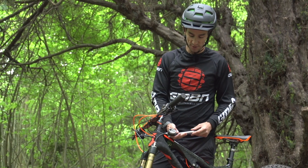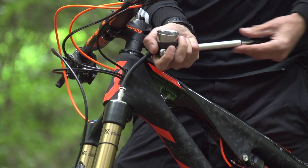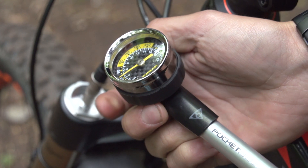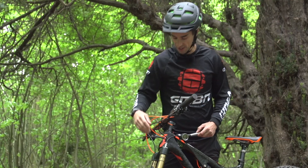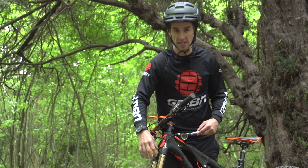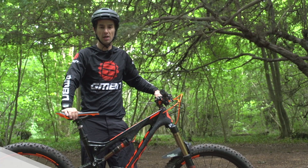The same theory goes with the fork — it's all about playing around with small increments of pressure to make this bike work for you on the trails you ride. You can go too far and have it too soft, and you'll end up sitting too far into that travel. Really, it's that first initial part of that stroke that soaks up the small bumps. With coil sprung suspension, you can have the same effect by adjusting the preload.